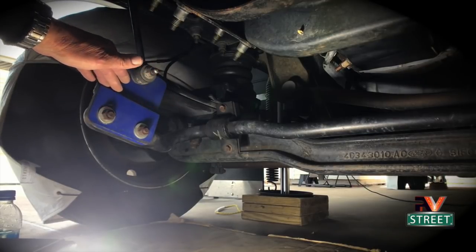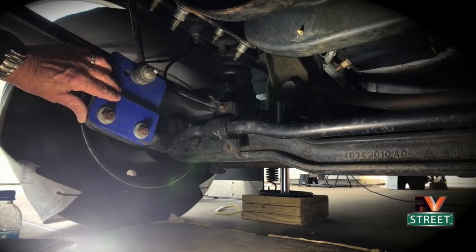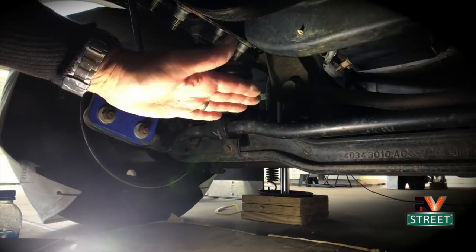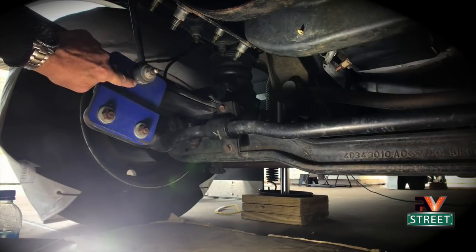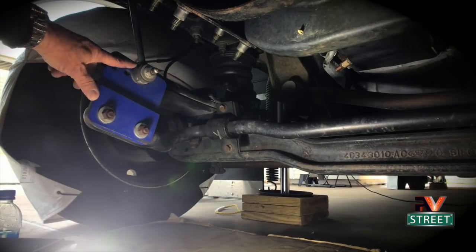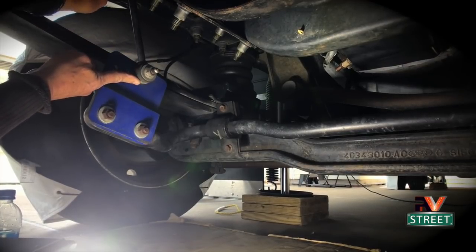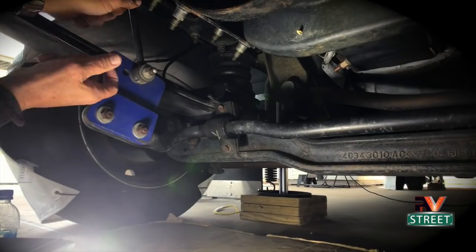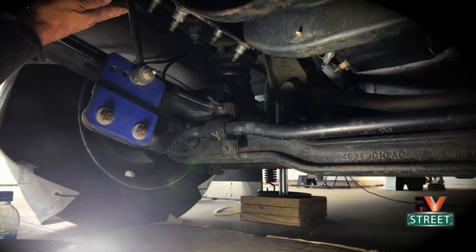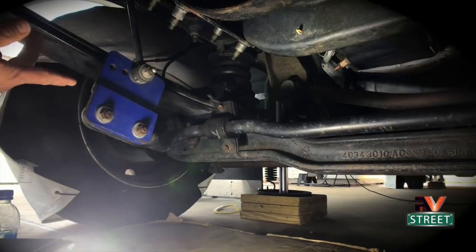He came up with this design, and I applied it four years ago. We've got tens of thousands of miles on this thing, and it did help with the rolling and the rocking of the motorhome. Instead of using this link on a bracket, Helwig sells an adjustable link — it connects up here, it's two-piece, a lot beefier, and adjustable by screwing it in to make it shorter or screwing it out to make it longer. I'll put a link in the description about where you can get that.